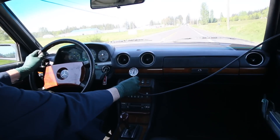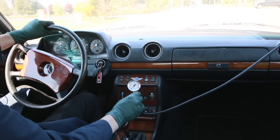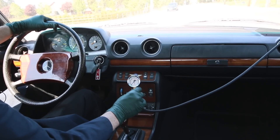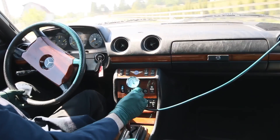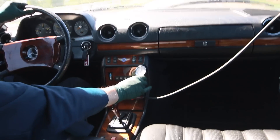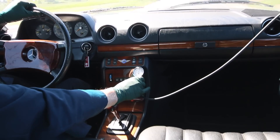Watch the gauge going right up to nine PSI, but I'm not getting any power. The thing feels like I'm dragging an anchor out here. Now when I make this turn I'm going to floor it - and once again it's just not kicking into gear like a turbocharger should. See the delay in which the power comes on? But look at the boost gauge - I'm right at eight. Now I'm going to back it off and floor it again. Right up to eight and eight and a half.